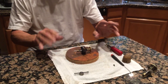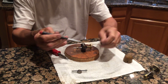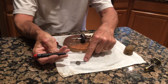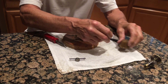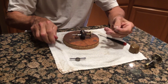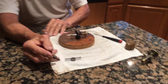So what you want to do is, because these screws are really, really tiny — and this is for demo purposes only — if you have a magnetic screwdriver, you can hold the screw for the spring. If you don't have a magnetic screwdriver, you get the illustrious beeswax. You put the beeswax in the slot; you can clean that off later when you're done. Take your screwdriver and set it in place.